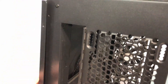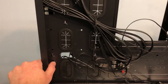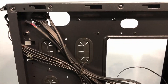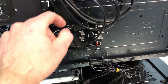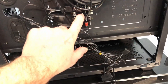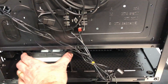Looking at the back panel, it's nice and deep — about an inch deep — which is nice because the more room you've got to route your cables the easier it is. Here is the little controller hub for your RGB effects. This is your SATA connector to power up the lighting control board, and then these headers interface with your motherboard if you do synchronization between the case RGB and your motherboard — a lot of motherboards do that now.